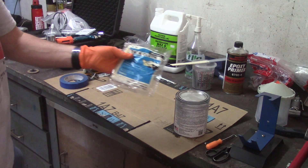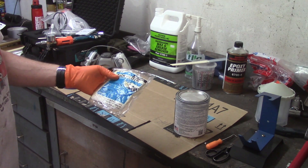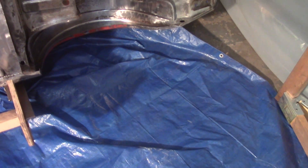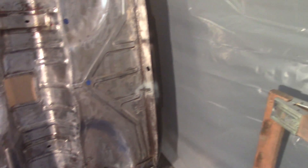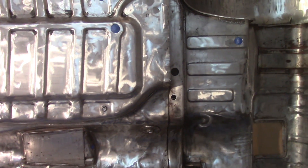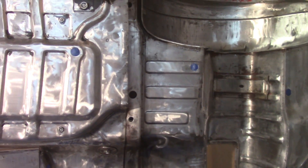Going to tack the car with a tack cloth I picked up at the auto parts store. The paint has been inducing for about 40 minutes. Got everything taped and masked, tack rag done, tarp down for incidental overspray to protect the floor. Board set up for test patterns. The leaf spring cover is on a sawhorse. Got the fan on low - with the flap shut it encroaches a little but not too bad. I'm going to get into a new Tyvek suit, keep everything as clean as possible.